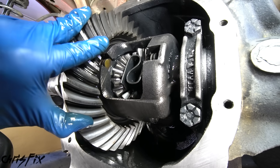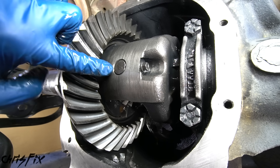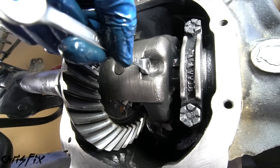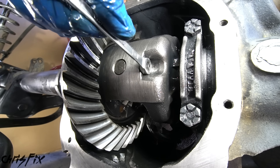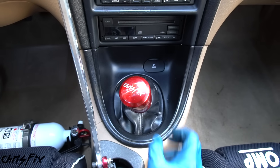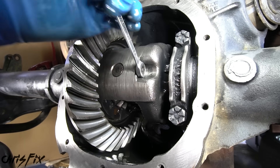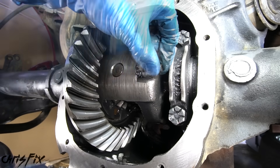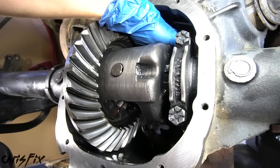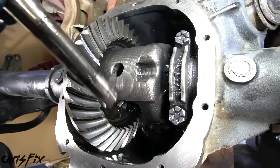The stock clutches aren't carbon fiber, but they do have these tabs, and you can see the tabs there. We need to get in there to pull those clutches out and install brand new ones. To do that, we have to turn the differential until we find the lock bolt, which is holding this pin in. This is an 8mm bolt and a ratcheting wrench makes this easy. Put the car in first gear — or park if you have an automatic — so the transmission holds the differential while we loosen the bolt. Then slide your hand behind the differential and push on the other side to knock the pin out, then slide the pin out all the way.